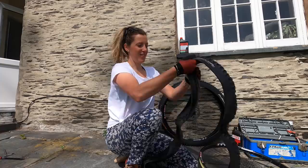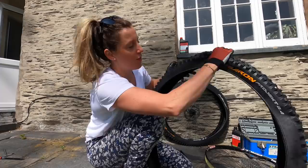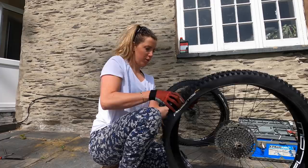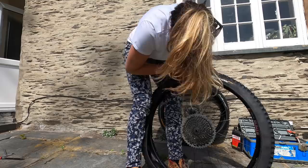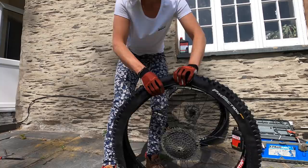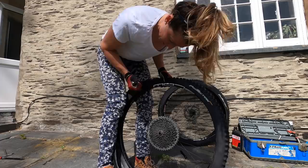Fresh rubber! You want to find the rotation of the tyre. Rotation is that way, wheel's going that way — so they should go on together. Get about three quarters on, use your knee as a little wedge. I'm not strong enough or manly enough to do it without tyre levers. So then you want to get your tyre lever and just winkle it on. And then she's on.